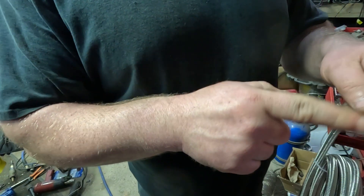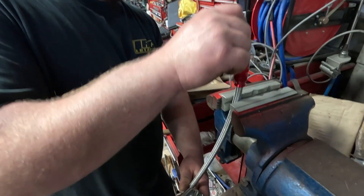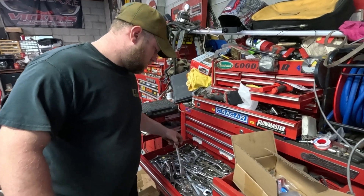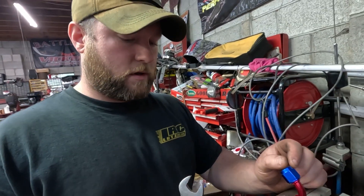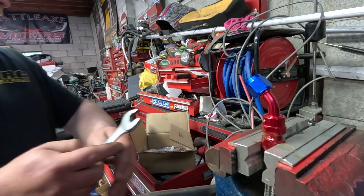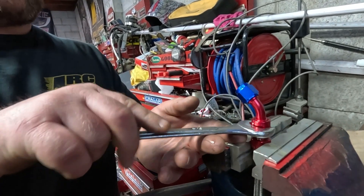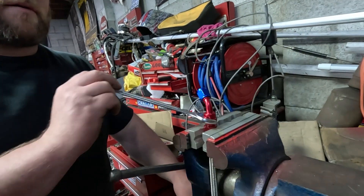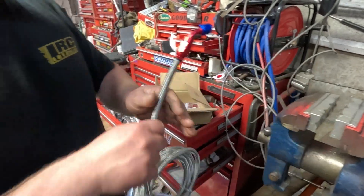The only thing left is we need a little touch of oil on that, just in case — it helps the threads so they don't bind. There's an aluminum insert that you pound in; the plastic tube inside the PTFE line has to go into the aluminum insert, and then the outside has to split around the steel braid — or nylon braid, if that's what you have. If you can find the right size wrench, it makes things a lot easier. Put a little oil on for the threads so they don't bind.